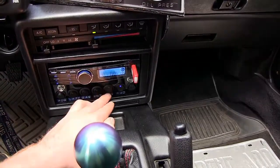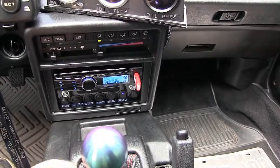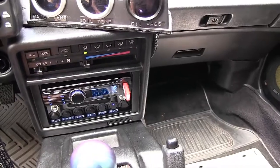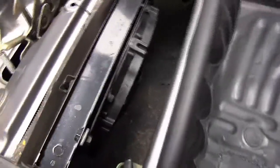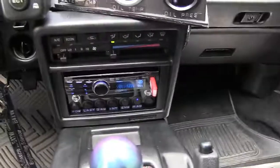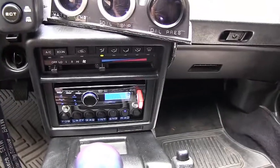When I manually disconnect this, I'm forcing the fan to turn on because I'm basically telling the computer that it has a really hot engine bay. The next one is the radiator fan — it's off right now and wouldn't turn on because the coolant is very cold. But if I activate the switch, you can hear it turning on now. And then I can turn it back off. I've forced the radiator fan to turn on by telling the computer the coolant temperature is really hot, even though it isn't — I'm forcing that signal.